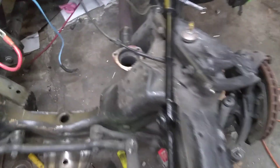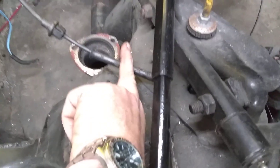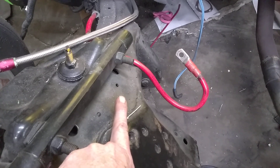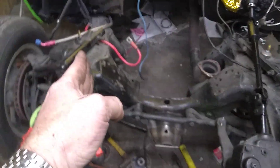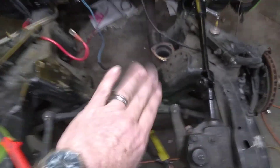If you notice right here, here's the top hole for the engine mount. If you look in relationship — put my finger straight back to where the back corner of that control arm is — see how that top bolt hole, that nub up there, is on the inside of where that control arm is. If you come over here and do the same thing, you can see where my finger's pointing — in a straight line, you're going to hit that backside bolt for alignment on the upper control arm. This one is inside the edge of the control arm, which shows you that the engine sets to the passenger side. If you ever look down at the engine in your car, a V8 especially, look at the engine and look at the frame over here — you'll see that it sets to the passenger side.